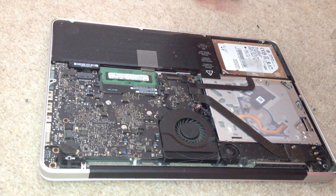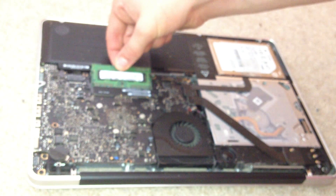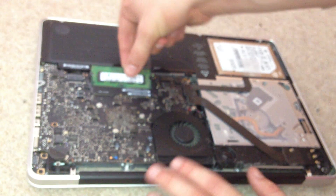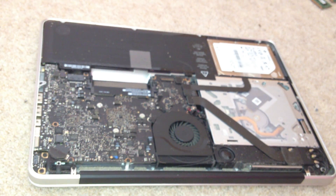I'm going to use it right here. So, basically what you have to do is flick these two little bits here and slowly pull that out. Put that to one side. And then the second one — do the same. Make sure it's not wedged, so you pull that out. And then we can see the new one here from Crucial. I'll open this up — I should have really opened it up to start with.